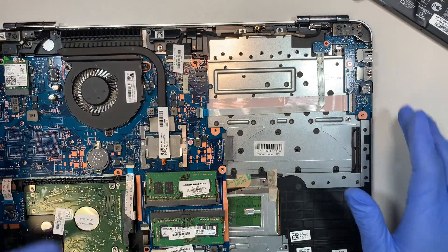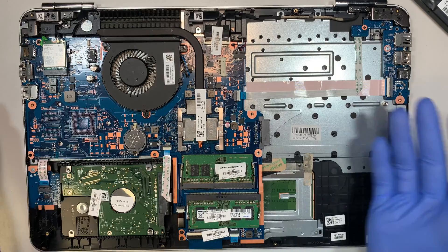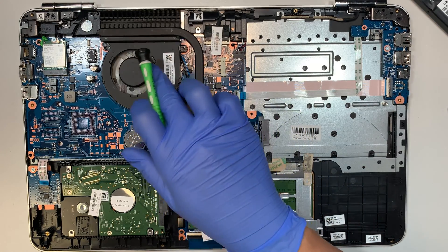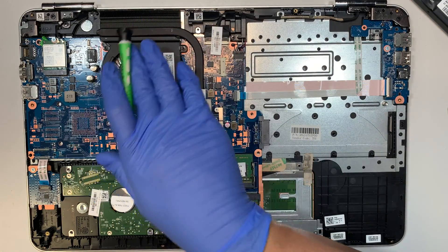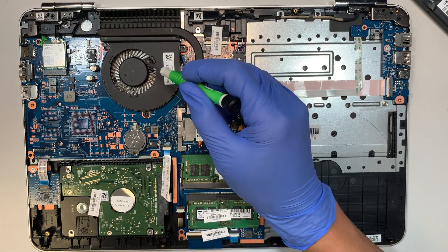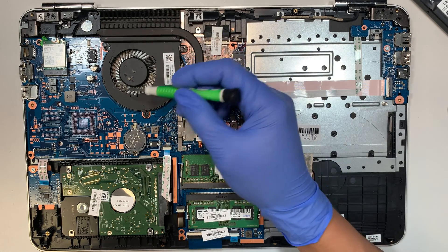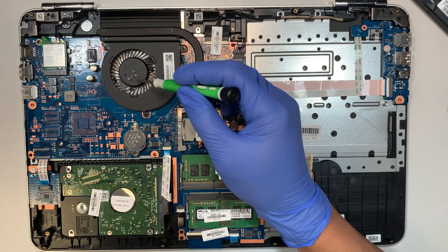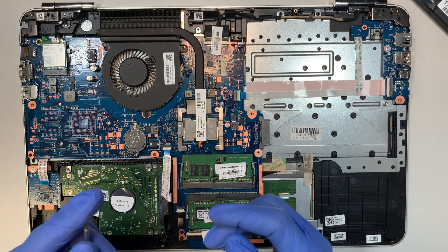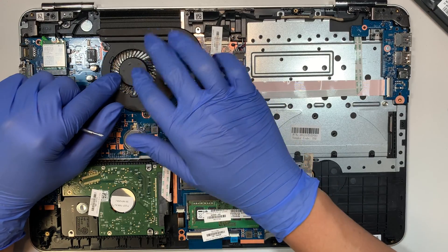Since the computer is open, I'd like to give a quick explanation for first-timers. This is your CPU fan which exhausts heat from the heat sink — the heat goes out in that direction. If your CPU fan is very dusty, you can see some dust and dry lint hanging around the blades. You can use a toothpick or screwdriver to scrape it off, or use a can of compressed air duster to clean off the dust.